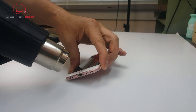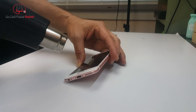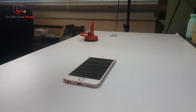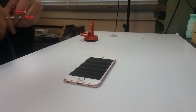I like to use a heat gun to warm this up because it makes it easier to work with, but if you don't have a heat gun or a blow dryer on hand you can still open the phone — you're just going to have to work a little bit harder. I do recommend that you wear safety glasses anytime you're working with broken glass or prying, because there is some possibility that the glass can fragment and end up in bad places. You definitely don't want that to be in your eyes.